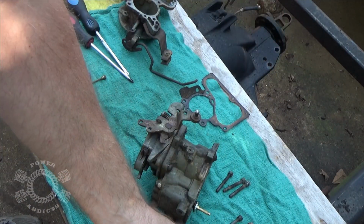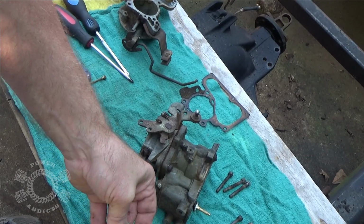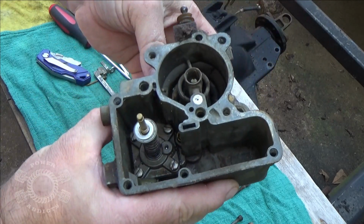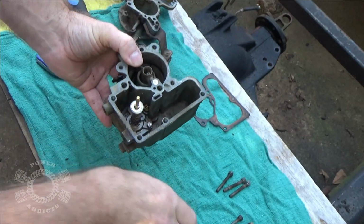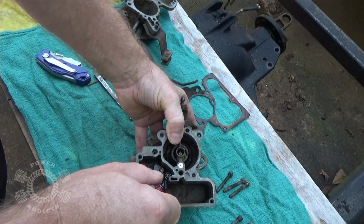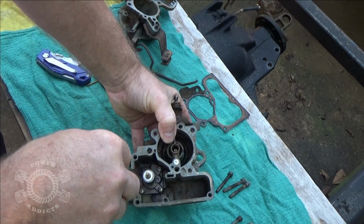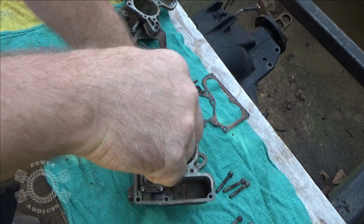So I spray that junk off and wipe it off so it slides good inside the carburetor. Okay, y'all get some old school lessons right now. Looking out through there, that looks clear. I'm going to check the accelerator pump. Hopefully I don't tear that up bringing it out. Because what could be happening is there's a diaphragm underneath the bottom of this. If this diaphragm is bad, it'll prevent it from pumping fuel down inside the carburetor.